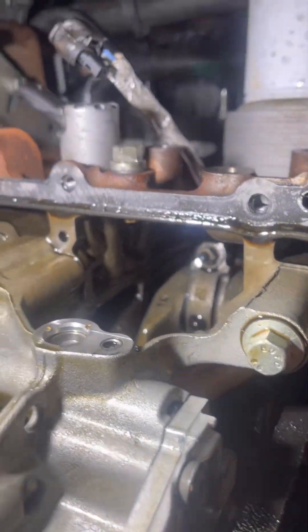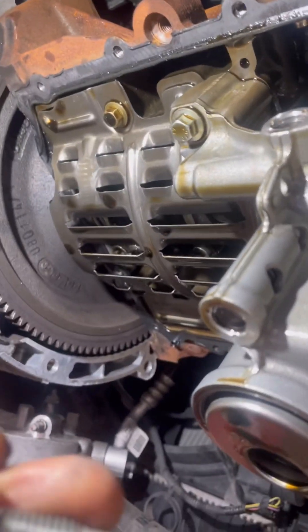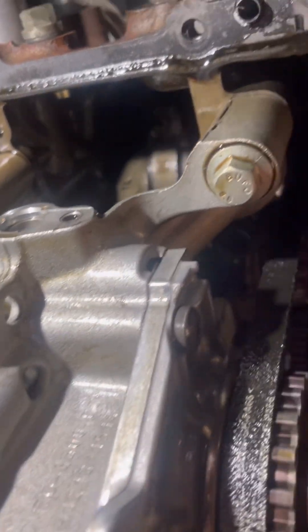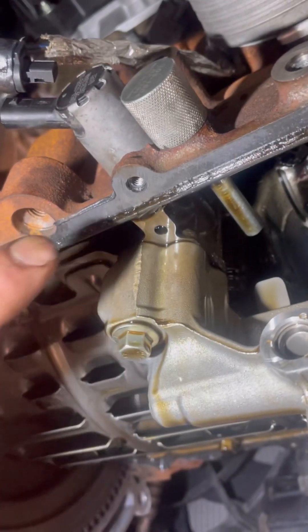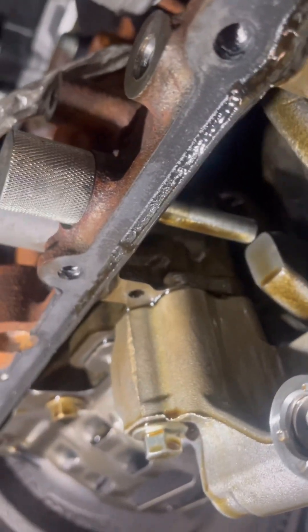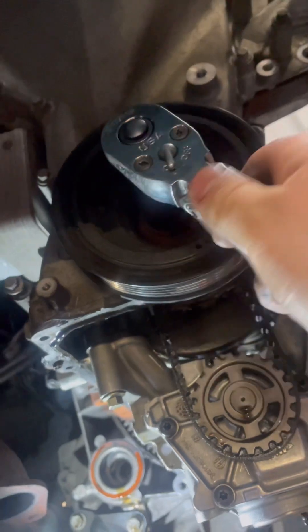This 10mm bolt is where we put the locking pin. I'm going to undo that, get the locking pin in place and rotate the engine until it stops. As soon as it stops we know piston one is at top dead centre, which is roughly where we should be. So we can mark the cams up and get the cams locked off. With the crank locking pin in place we take the crankshaft and push it all the way up to that stop. We also need to remove the crank position sensor, then we can get the other timing tool to remove the crank bolt.